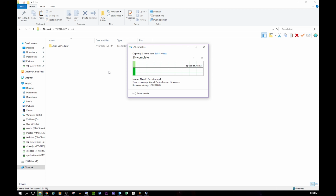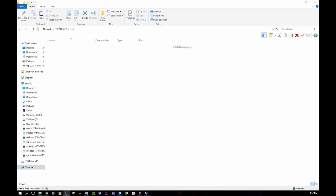But as you can see, the write speeds are about half of what I should normally expect to see while the Parity is building on those drives. Alright, we're going to try this one more time. One thing I forgot to do is I have set OBS and Premiere to run off of a network share on my Xpenology NAS, and I needed to set OBS to record to a local hard drive instead of over the network, because it's going to throw off my bandwidth, my transfer speed settings.